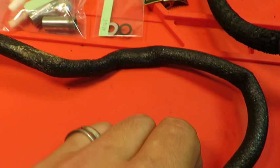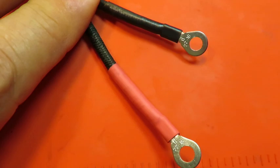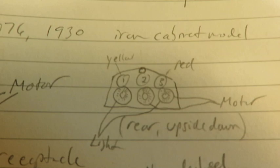And then on the other end, where the lead wires connect to the electrical terminal, they needed new rings, which I was able to put on there. I used color-coded shrink wrap tubing, red and black, because that terminal is color-coded, as probably a lot of you have seen, with the yellow or red and a black port, and so now I know where those go.